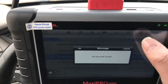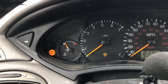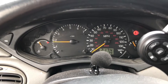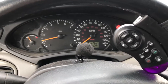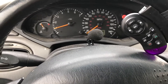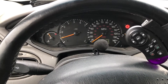We are going to close out of it. Now we are going to see if that airbag light is off — let's see if it comes back. Turn off, turn on. Boom, it's gone. So that's how you reprogram an airbag module. I had the Autel MP808. If you guys have any questions, feel free to leave a comment. I'm also going to throw the specific scanner I bought in the description.